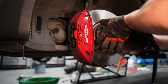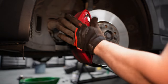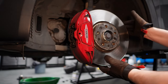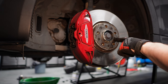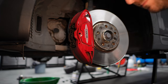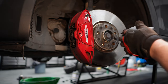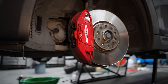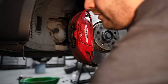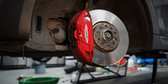I'm going to remove my spacers — they just are sitting there. Here we're looking at the caliper and the rotors. The rotors have a six millimeter screw that holds them in, so use a six millimeter Allen on your impact and it should come right out. I bought stainless replacements, but you don't necessarily need to — I didn't have any problems with mine.